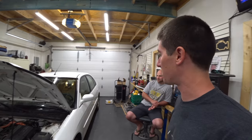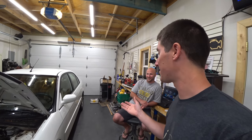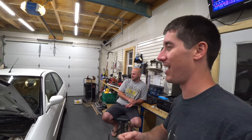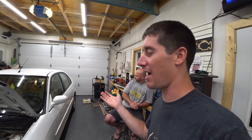We've got to tear this battery apart, get a meter on some of the cells, and figure out which ones are bad. From what I've seen, there should be holes in the cells that are bad — they fail so catastrophically in these. They'll have burn marks outside and visually you should be able to tell which ones are bad. We're going to find out if that's true and get the big IMA battery out of the car.